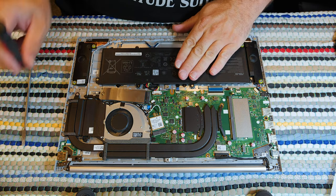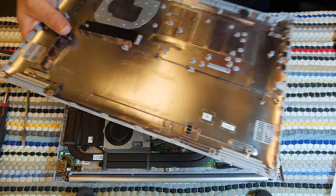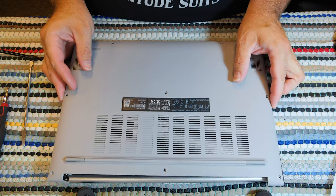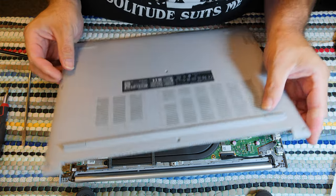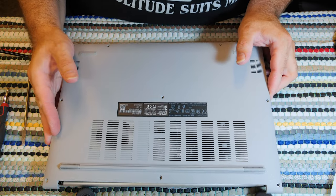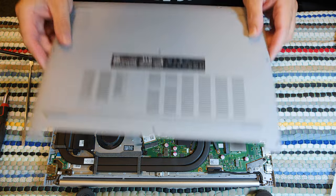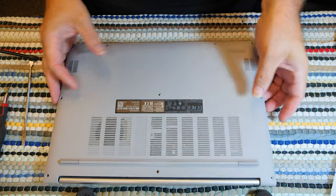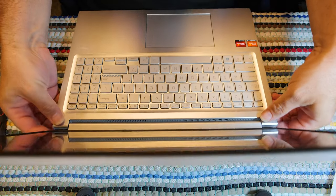I'm noticing there's not really much otherwise, and one of the things that I like to do when I get in any of this kind of stuff, if I'm already in here and I'm already modding stuff, is use thermal pads to bring this up to the actual chassis. I don't know if I'm going to do that this time, though, because the thermal paste was such an obvious and serious problem with this one. I think I'm just going to not bother. Well, real quick, I'm going to turn it back on and see if my product is destroyed by whatever shorted it out there a minute ago.